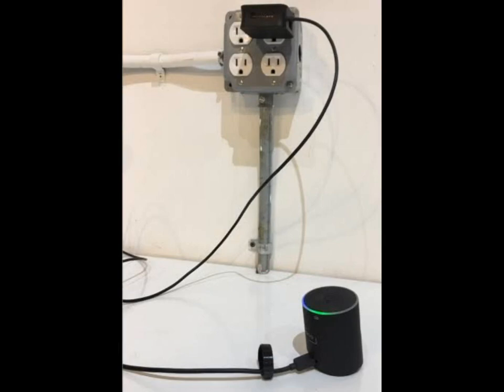3. Plug your modem's power cable into an electrical outlet. A wall socket or a surge protector will do. It's important to plug the cable into the power outlet before connecting it to the modem, since connecting the power cable to the modem first can cause damage.